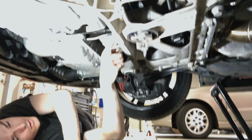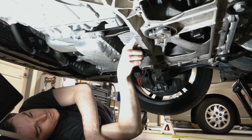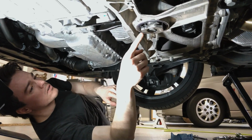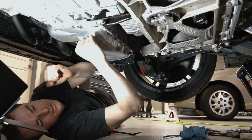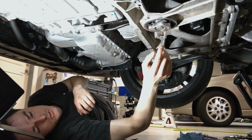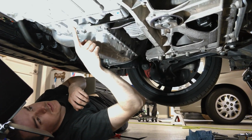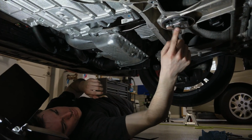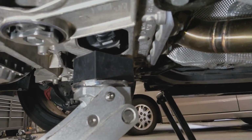Maybe not. Where we left off, we had an issue with the storage card for Kyle's camera. We were struggling to get the upper Dogbone mount up all the way, so we took a pry bar and just gently got it, and it finally popped up. So we got that in, then put the Dogbone mount that mounts to the bottom of the transmission in. Got these two loosely in, as well as this. Basically, you want to get all the bolts in position, but not snugged up yet.